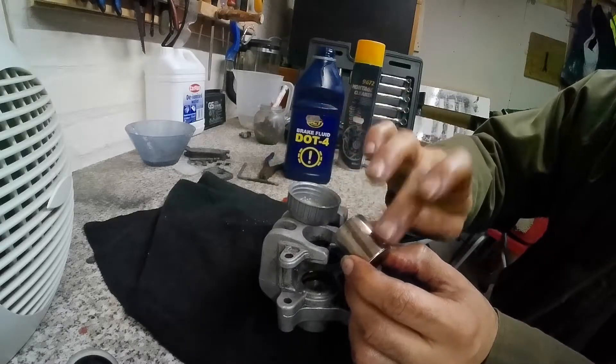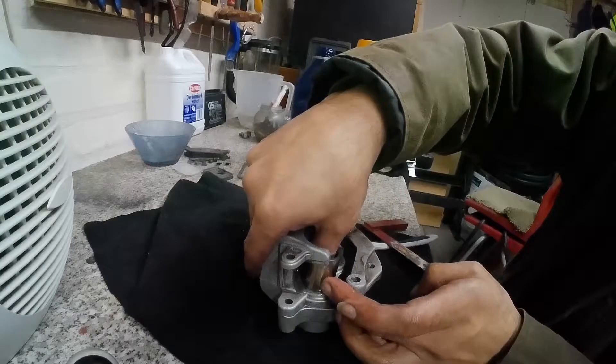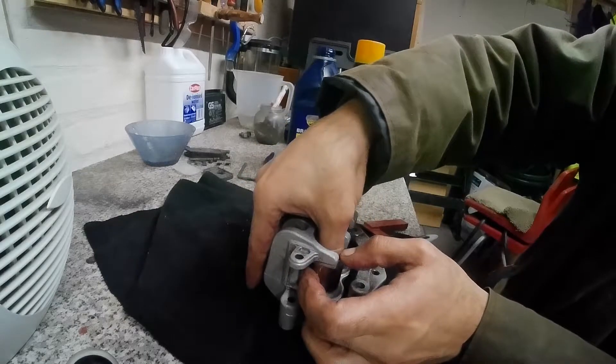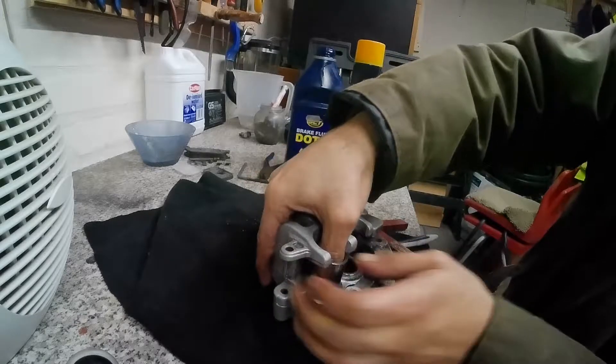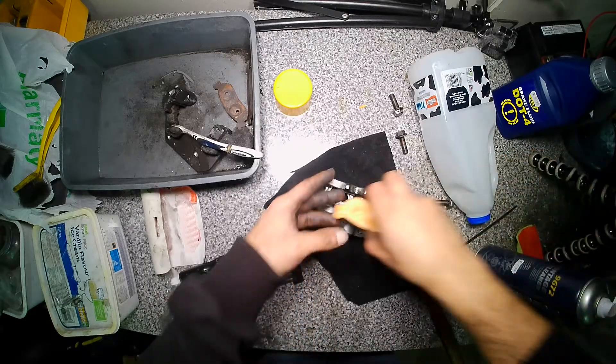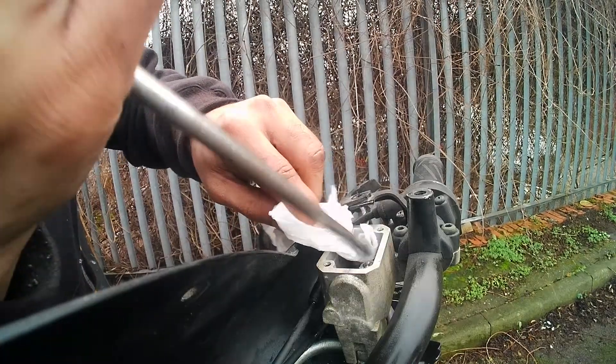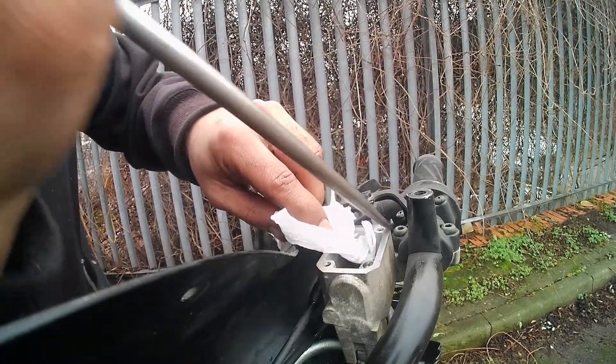In this case I rebuilt the pistons. There is a separate video about each of these in detail that you can look at, but these are just tips to look at when you're trying to start your bike — because when you're riding, your brakes are going to be your main thing to stop you. I'll put new pads in the back, and we're going to get some reservoir cleaner for the master cylinder.